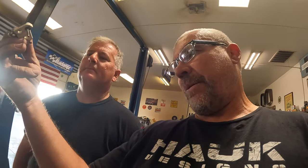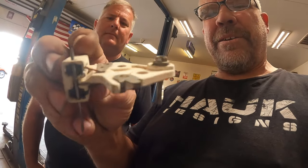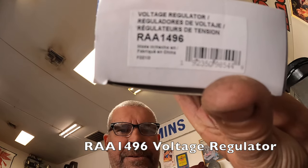So Jimmy, do you think you can turn an alternator into a welder? Yeah, it's pretty simple when you break it down that way. This right here is your GM brush contact. You've got a brush over here that wraps around and makes contact with one of these terminals, and the other one goes underneath. All you have to do is ground one and hook a wire to the other and run it outside the alternator, and use an external regulator - this is just a standard Ford regulator. You can buy these at the auto parts store with the pigtail. I have the part numbers here.